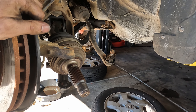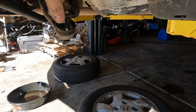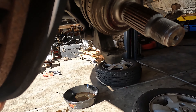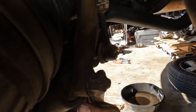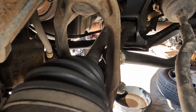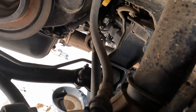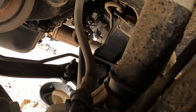I got the axle out of the knuckle assembly. This tie rod boot is busted, and I'm going to let the customer know — right now would be a good time to change that while the transmission is out. All I do is just loosen the lower control arm. If you want to take the axle out completely you're going to have to remove this nut and bolt that holds the strut fork to the lower control arm, but I'm not going to do that. I'm just going to pop the axle out and lay it on the exhaust.